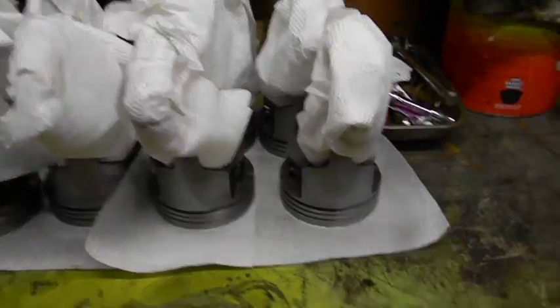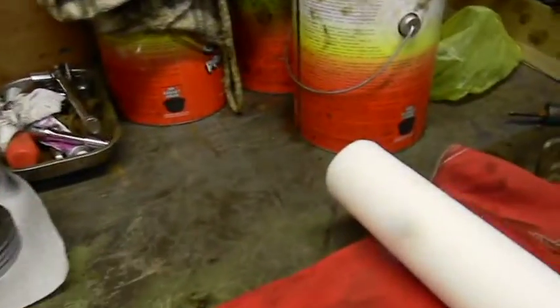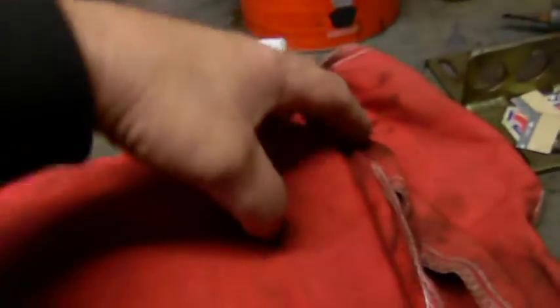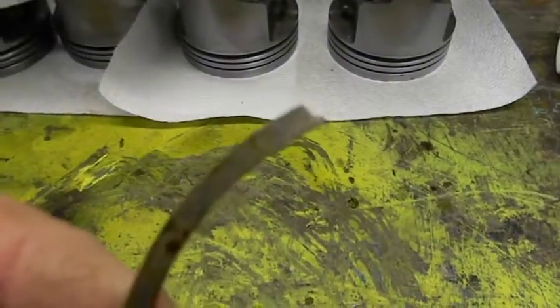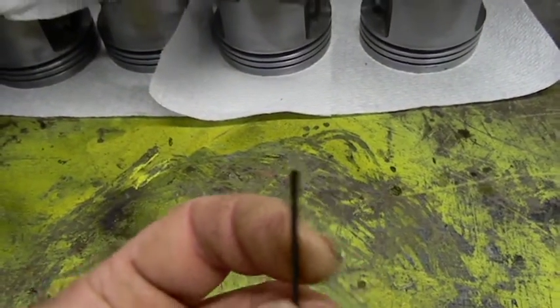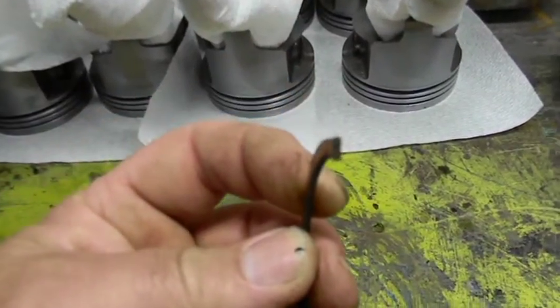I went through them one at a time. I cleaned them, used some cleaner, hooked them up in the vise, went around with my ring groove cleaner, re-soaked them again, then went in there with a broken ring — there you go, doing all this. You can use the square end; don't use the end you broke. Just got to be careful because there is a taper to it, so as you're cleaning, only clean three quarters of it.